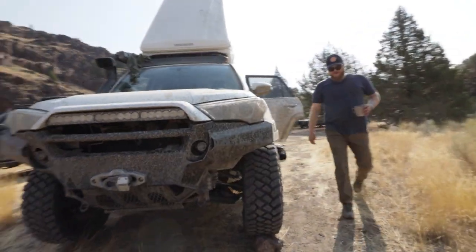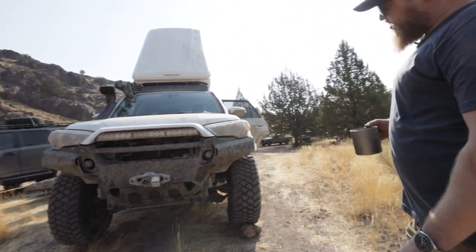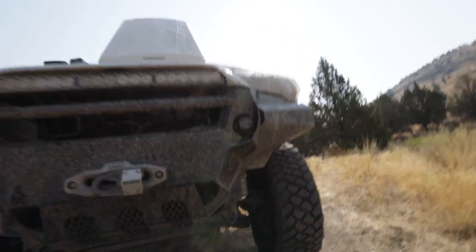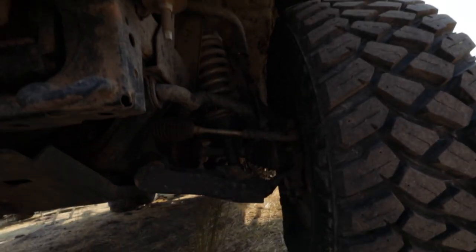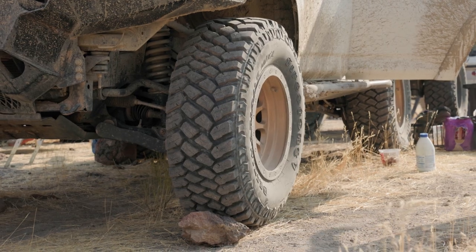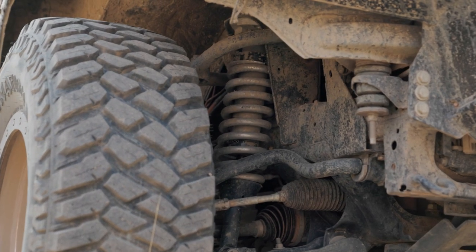And what are we rocking for suspension on this? The suspension on this is currently Radflow 2.5 up front, 700-pound coils, and ADS 2.5 with external reservoirs in the rear. I have ADS for the fronts. They're getting rebuilt right now. Okay, I was going to ask. I love me some ADS. Oh yeah, Tyler at ADS.